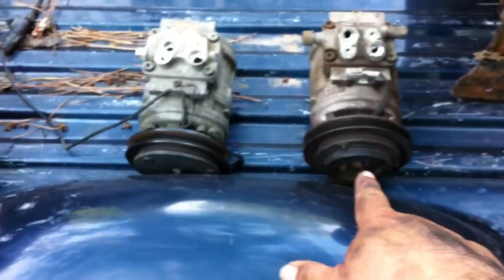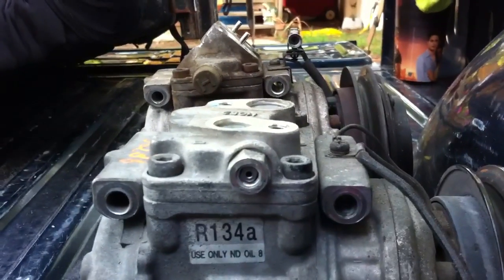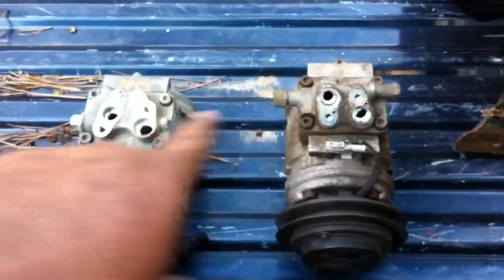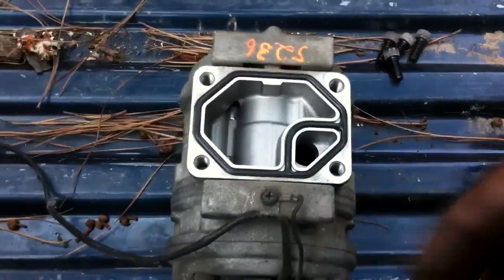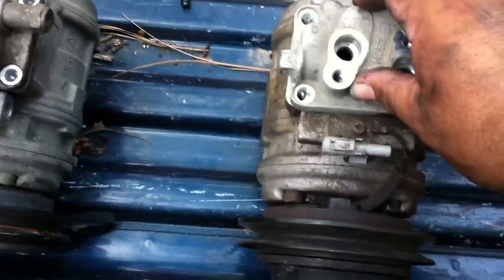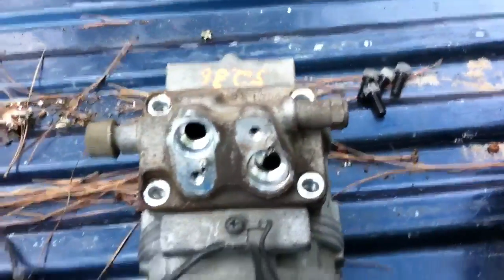They're very similar except for one thing. See the head on the old one? And then on the new one — can you see the difference? What we need to do is transfer the top of the old one to the top of the new one. I already swapped them, but I wanted you guys to see — that's the same bolt pattern. I put the gasket on that one; the gasket's going to come off the other one. When you pull the other one off, it's the exact same pattern — all it is is a different head. Be careful not to get any dirt; clean out your holes before you put it back on.